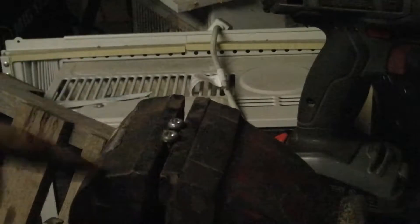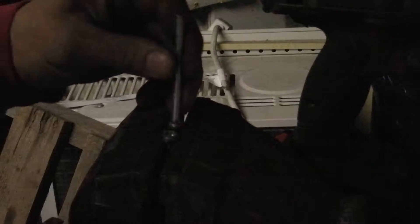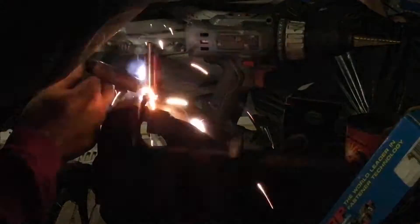I've grounded my welder through the vise so I don't have to hold the screws. I've got two lined up right here and two rods ready to go. Got a little tack weld on there. Here's one finished other than paint — I'll probably paint them black. There's the screw, the extension, and then the T welded on.